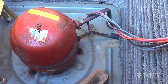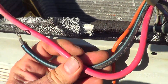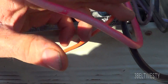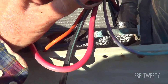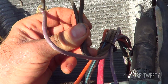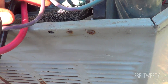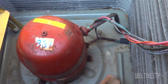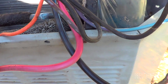There's a wasp in there, and then there's a sensor. These two big ones are the main wires for the compressor. Orange goes to one of the caps. These three are for the compressor. The black zip line goes to the heater, and then the two purplish-blue ones are the ones that connect to the center connector here.